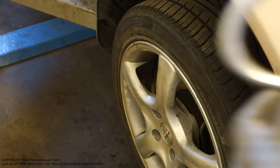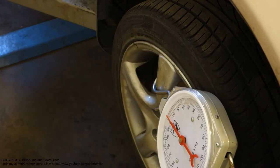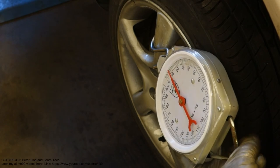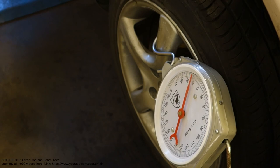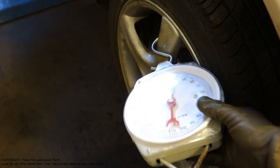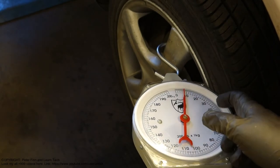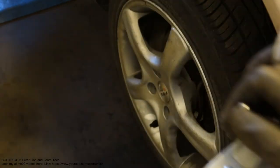Okay, now we are in the right area, and I insert my scale in here, and we look at how much force there is. It should be like 40, so let's look at what it is. It is now 30, and at 40 it starts to move. That means these amounts are so similar that when there is 40 kilos, there is similar braking force and everything is fine.